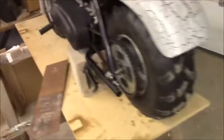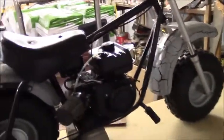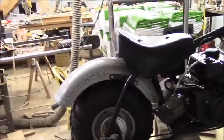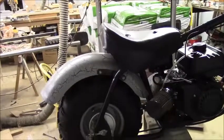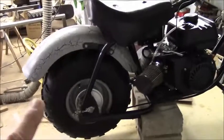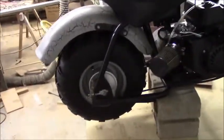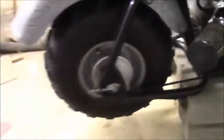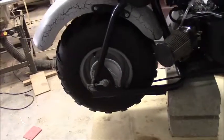I think it was one of those cheap $50 ones from eBay. I've got a lot to do to this to get the trail bike ready for hunting season coming up in a month. Got to paint these horrible fenders — going to do some camo leaf on that like I do with my hunting rifles. Going to work on the rear brakes because they squeal like crazy. I'm going to pull them apart, see if they're all glazed up, and try putting some rubber compound on the drum itself to stop the squealing. Ultimately if that doesn't fix it I'm going to order some that are supposed to be quieter.